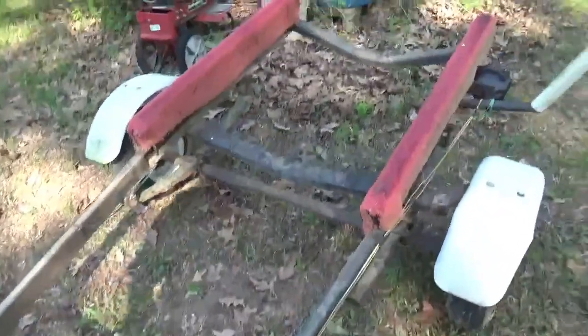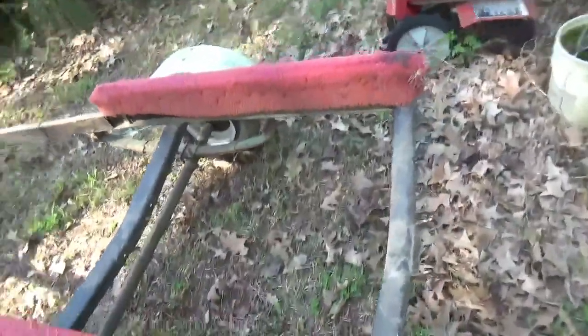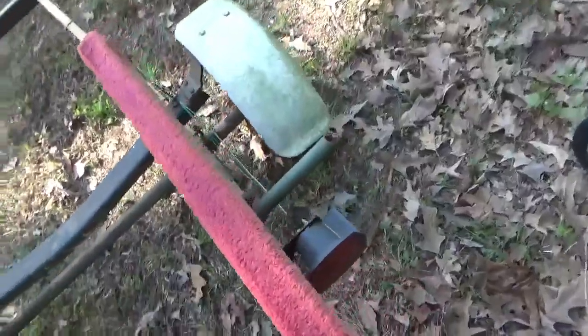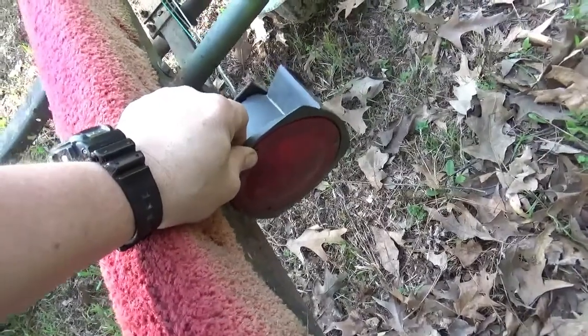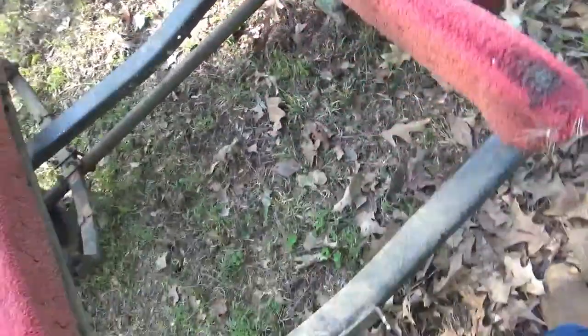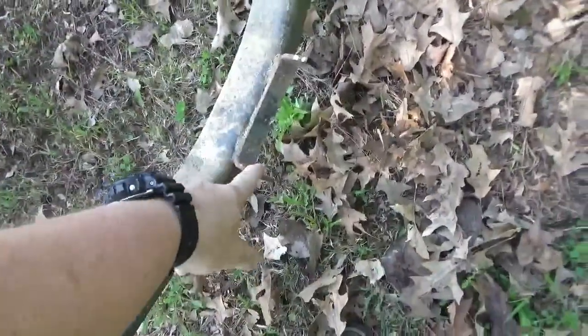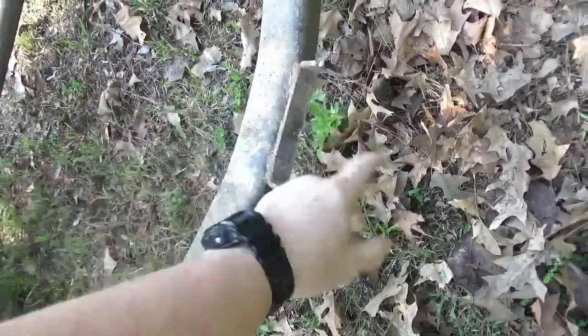See, that cross member is welded. We're gonna check all these welds. We're gonna pull these bunks. We'll pull these brackets. There's another one over here that's actually broke. See, these tail lights are not sealed lights, so I have to unplug it from my truck every time I back it in the water to keep from shorting out the lights. We're gonna get rid of these and put sealed lights on. Actually, I may cut this bracket off just because it's in the way.